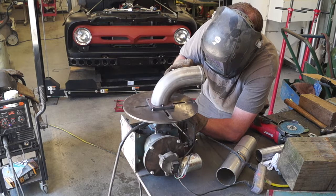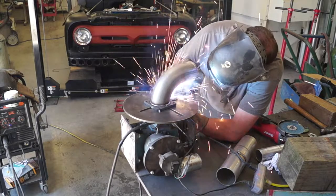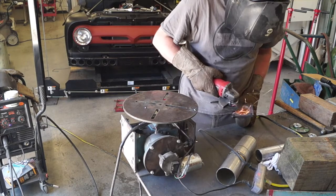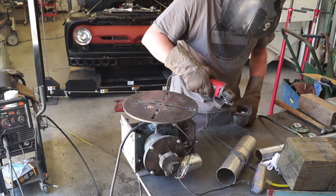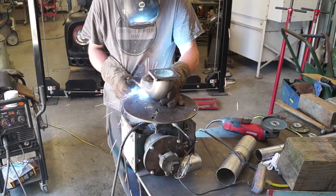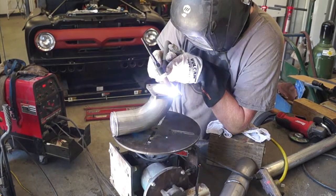For the air intake flange, I mount it up on the turntable and use the MIG welder to weld our DIY flange kit to that mandrel bent 90. The MIG welding is primarily just for rigidity on the pipe. After that I grind any remaining three-inch pipe that's sticking out, being careful not to get into the sealing surface of that flange — you want to be really careful not to put any grind marks in that sealing surface. Once it's all even and you have a nice tight joint, mount it back on the turntable, do a final seal and a small weld along the seam, and then file it completely flat to make sure there's no warping and it has a good sealing surface.